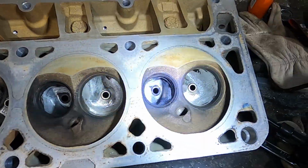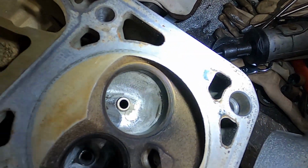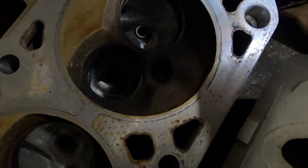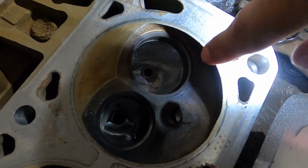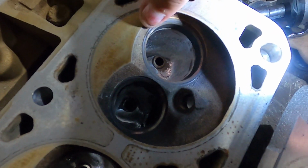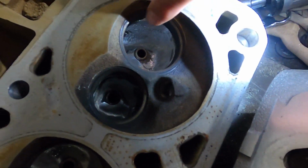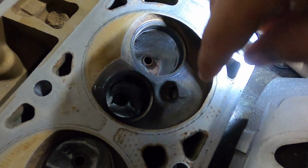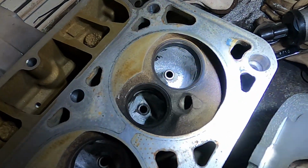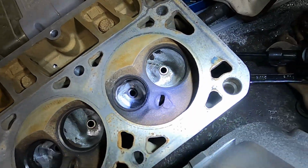untouched as far as chamber. So you can't really tell, but all the edges and everything are almost knife edged, like all around here. And it's even sharper around there, even though that's kind of an off angle. But if you were to push hard enough, this would probably actually cut you. Now that little ridge right there can actually get hot enough to cause detonation.